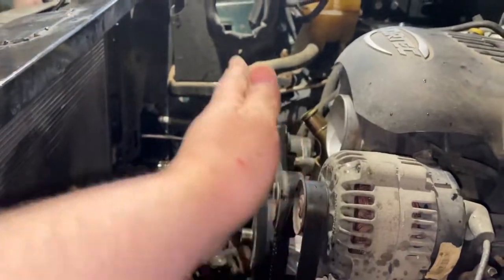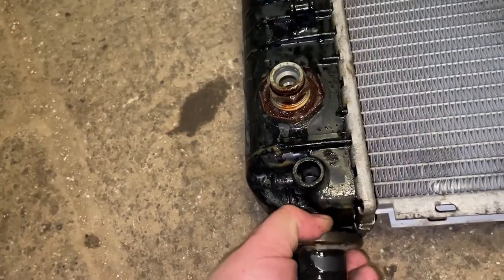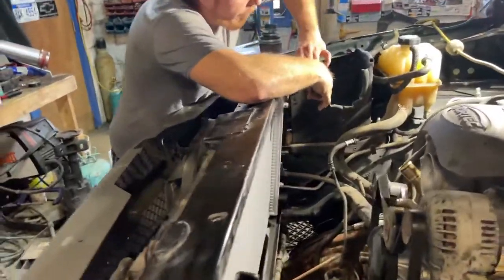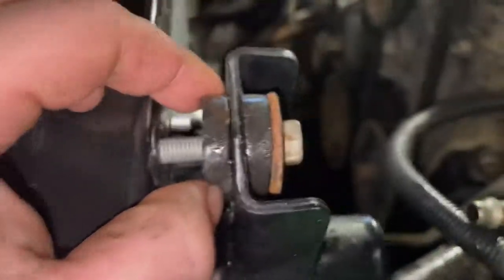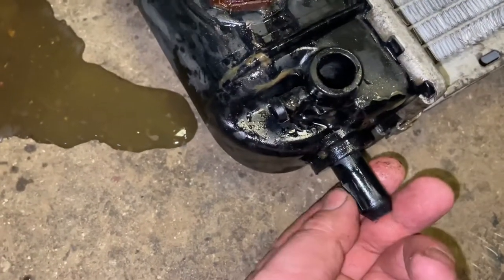We'll keep that lower radiator hose and trans line connected and forward while Jamie finesses the new radiator in. We can't forget our rubber stoppers at the bottom of the radiator — you see those two big holes on each side the radiator goes into. Usually the new radiator does not come with these rubber pads at the bottom, so make sure you transfer those over. We'll drop this new radiator in. We transferred our upper bushings over — half on one side, half on the other. Some of these radiators have a little clip on the lower bushing; you put a screwdriver in there and close the clip to get those off.